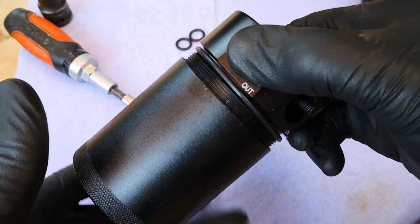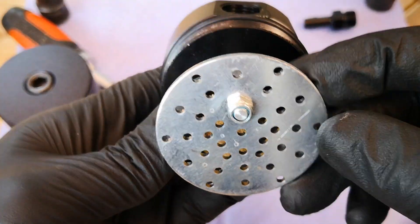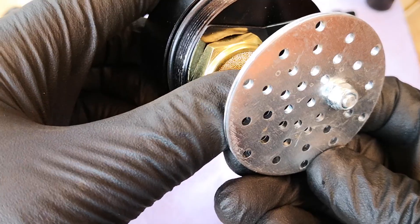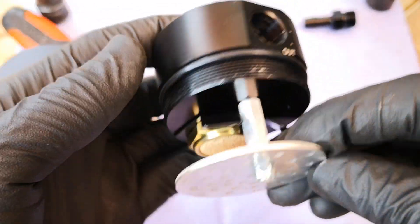Here's why I'm doing this. You can see the level of buildup on the pistons, and some of this is definitely due to the oil vapors coming from the PCV system, which get recirculated into the intake manifold where they form deposits on the back of the intake valves, particularly on GDI engines. It also extends into the combustion chamber. The oil vapor acts as an impurity in the air-fuel mixture. An oil catch can mitigates this by incorporating a baffle plate inside which helps to cool and condensate the oil, before the cleaner air passes through the filter to the intake manifold.